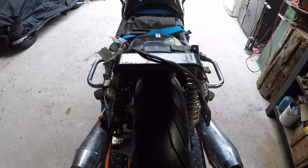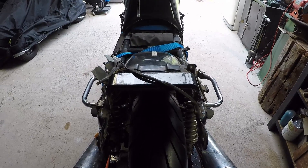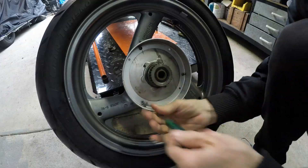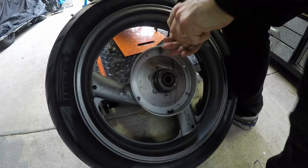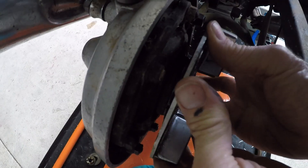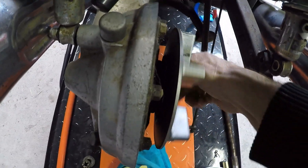Welcome back. In this video I keep working on the rear rim conversion. Where I finished last time was I got this rim fitted with a 150 tire, but it's a little bit offset - probably about eight millimeters to the right. So I pulled it apart; this is the main drive out of the rim, and this is where I see the opportunity to do a bit of machining and move that closer to the diff.